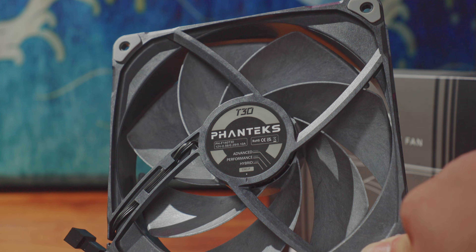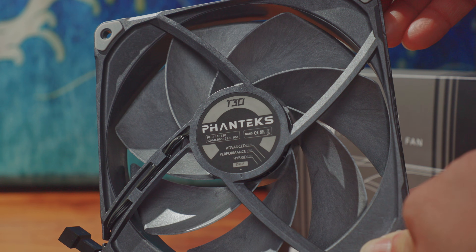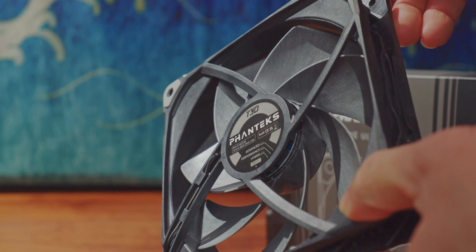That 2,000 RPM setting will be fine for most applications, but you do get to choose how granular you want your fan curves to be in your motherboard settings, or set a hard limit here. It uses a three-phase motor and a maglev bearing system from Sunon called the Dual Vapo — also used on the 120mm. That bearing is quiet and doesn't need lubricating oil. They all carry a six-year warranty.